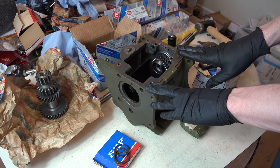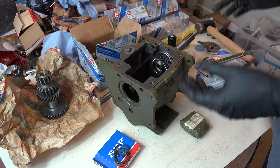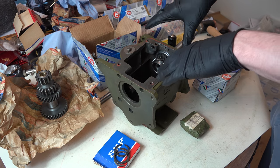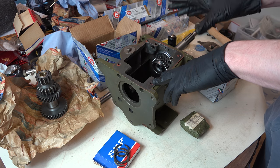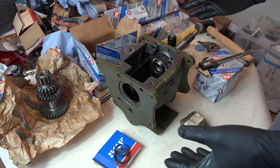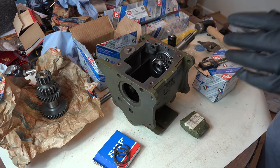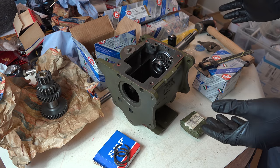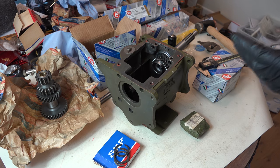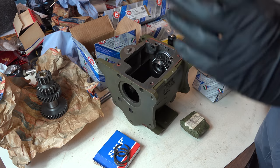It's time to build a transmission. I'm not particularly fond of building transmissions - they're a bit of a fiddle. Engines are better, but it's time to build this T84. The great thing about the T84 is it's pretty simple to do, but it needs to be done correctly. Although it's simple and will run until it falls apart with really terrible tolerances, when you're setting it up you need to do it right. The first thing is correct components. There are loads of repro bits out there - some good, some bad. The TAS stuff seems to be the best. We've got a couple of grand's worth of components here ready to build this transmission.